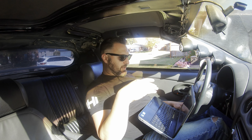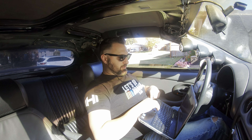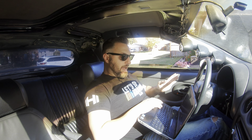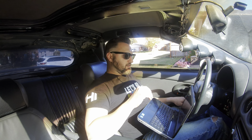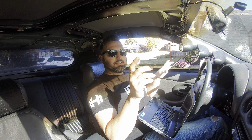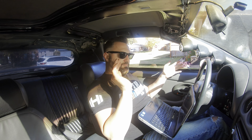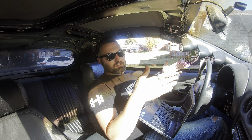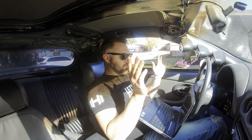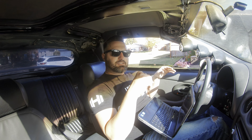I got it all warmed up. I'm flashing it back to speed density mode. It was running really good - it wasn't missing, it was revving really good. I'm turning the O2 sensors back on and putting it back in speed density mode. I'm going to double-check all these VE tables and stuff. Those spark plug wires will sometimes melt and touch against the header, and then it'll cause really bad misfires. It'll actually short out and kind of send voltage back to the distributor and cause havoc - it'll spread spark everywhere. So just word to the wise. We're going to go ahead and tune in speed density mode again on this car.